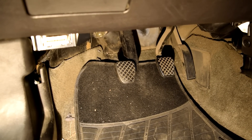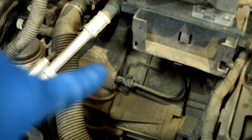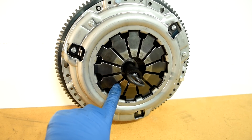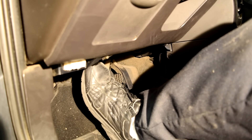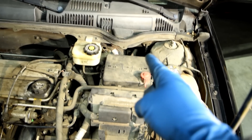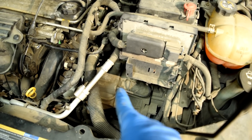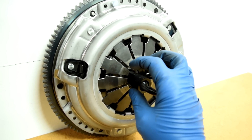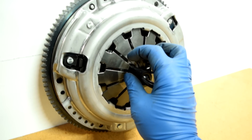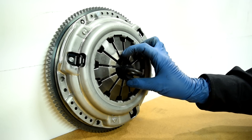In order to be able to shift gears, we need to find a way to disengage our clutch so that the full torque of our crankshaft is not continuously going through our input shaft. That's where your clutch pedal, your clutch master cylinder, and your clutch slave cylinder — which is inside the bell housing on this car — and the fingers on your pressure plate come into play. When you depress the clutch pedal, you push in the connecting rod at the back end of your clutch pedal assembly, which goes through the firewall into your clutch master cylinder and squeezes the hydraulic fluid. That hydraulic pressure goes through a line to your clutch slave cylinder, and the piston of your clutch slave cylinder — which has a bearing where it makes contact with your pressure plate — presses down on the fingers of your pressure plate. That bearing is called the clutch release bearing.